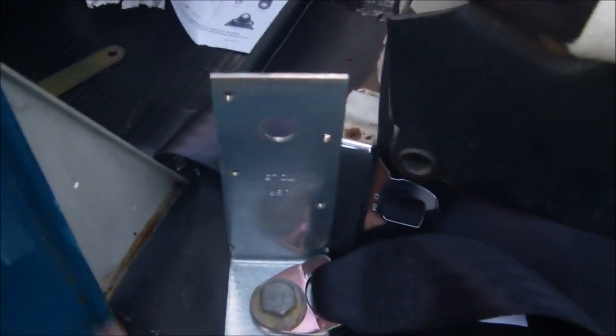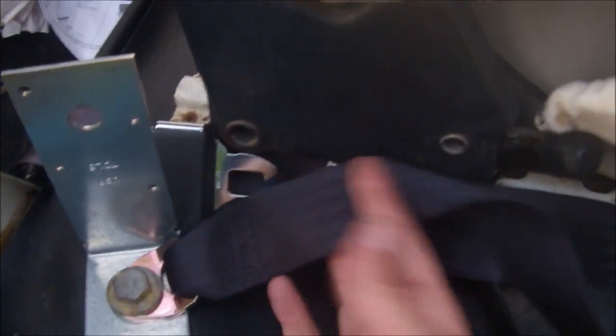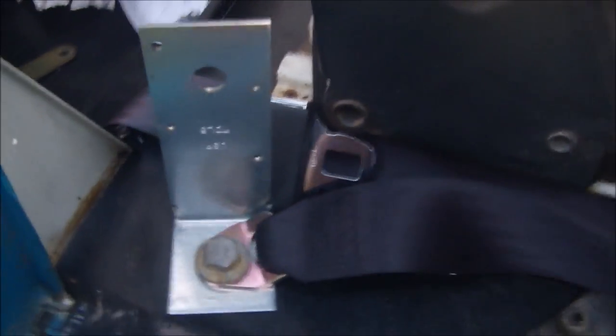Here's the first piece done. You want to make sure that this seat belt part is facing front towards the seat, because if you do it the other way it's going to be all jacked up — trust me. So now what I'm going to do is install the bigger piece, the part that has the retractable seat belt, and I'm going to install it just like so.